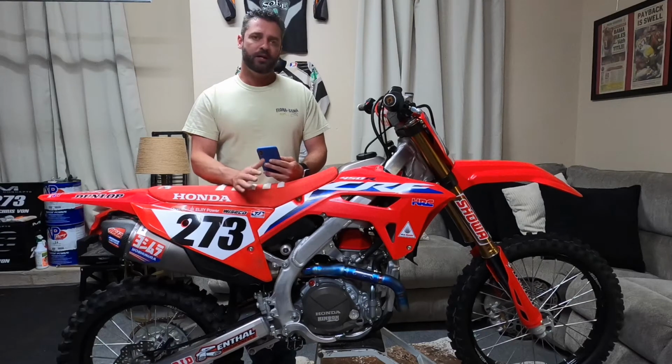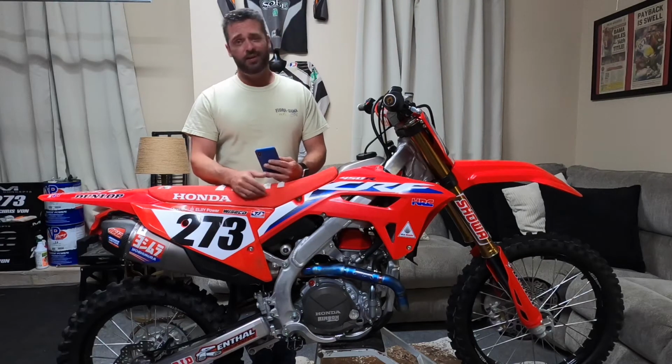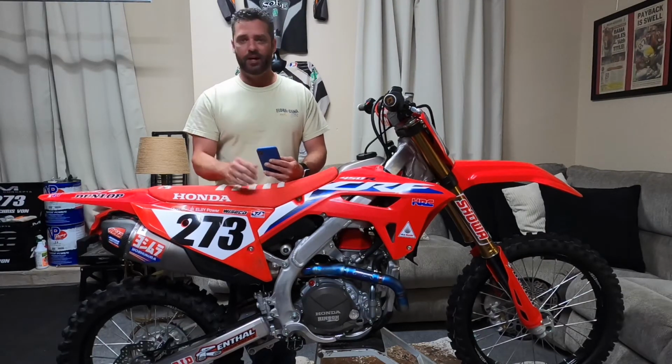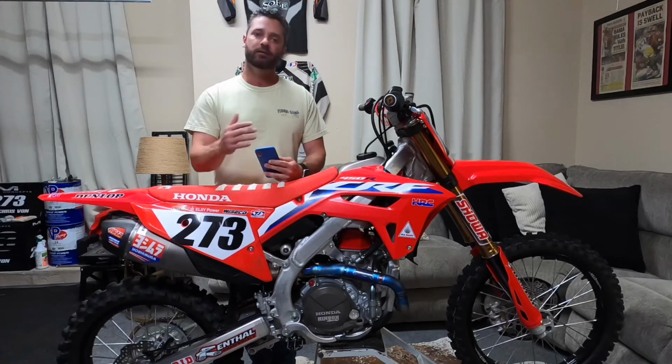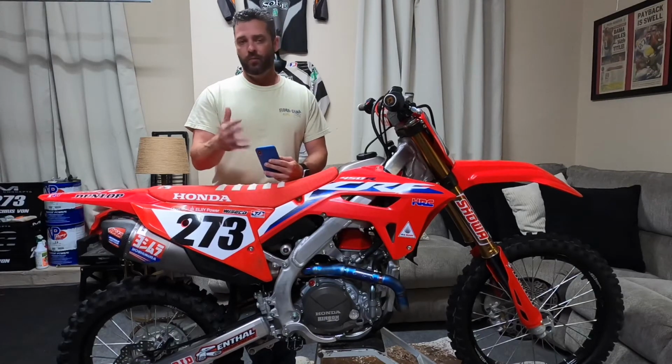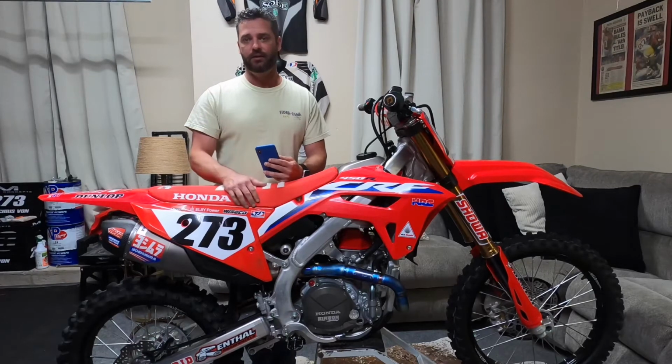I don't really know how Honda's going to address that issue, but needless to say, if any of you are having some more hiccups after the remapping and you're running race fuel straight, do not do it. Cut it back. Only run 1 gallon. I'm running 1 gallon T4, 2 gallons non-ethanol.